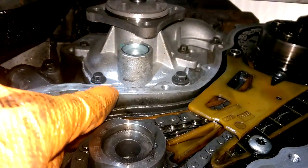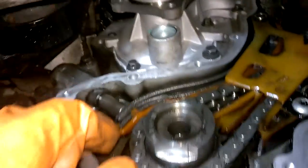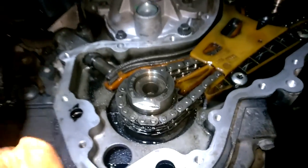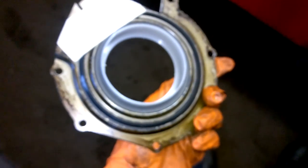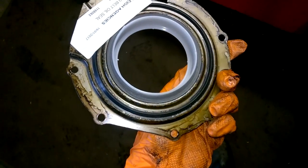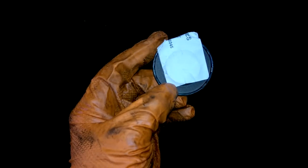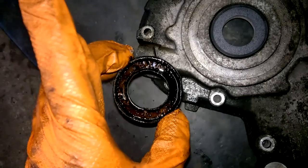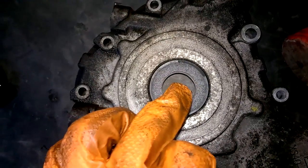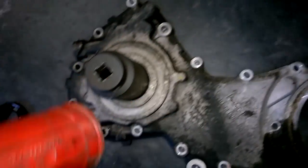The water pump is now back up in position — that's the new water pump. These are all 8mm bolts except for one 10mm. Make sure you clean around the surface well before putting the new water pump in. I've cleaned the area where the aluminium housing will be going back on. Once you remove the seals, you'll need to replace them. That's the big one that sits around the pump, and this is the smaller one that sits around the crank pulley. Make sure you get them if you're doing this job because they will leak — especially the crank one. Old seal taken out, new seal knocked back in using a socket the exact size and a dead blow mallet.